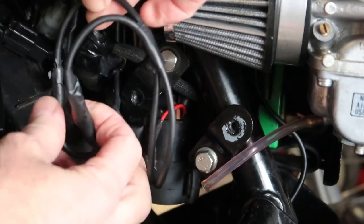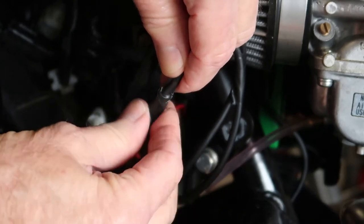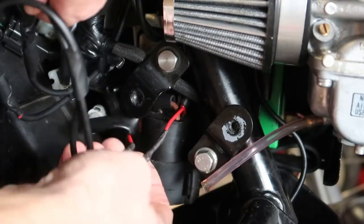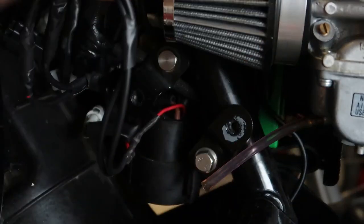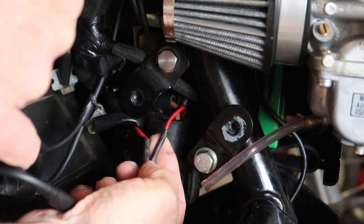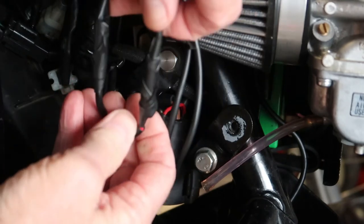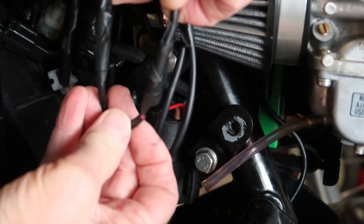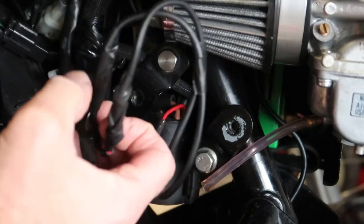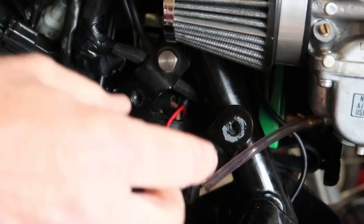I've soldered them on — you can't see them here because I've got them taped up. They're insulated anyway but I've put some extra tape round. I've put some bullet connectors on, and the two leads from each side of that red wire go to each terminal and up to the ammeter and then back to the other side. So that lead effectively has been extended up through the ammeter and back. The reason I used bullet connectors is because if something goes wrong with the ammeter or I need to disconnect it for any reason, all I need to do is pull the bullet connector apart and just reconnect the two leads together, which completes the original circuit.